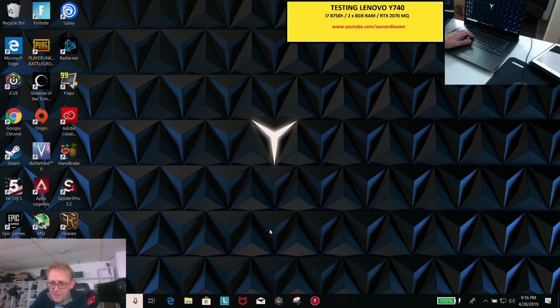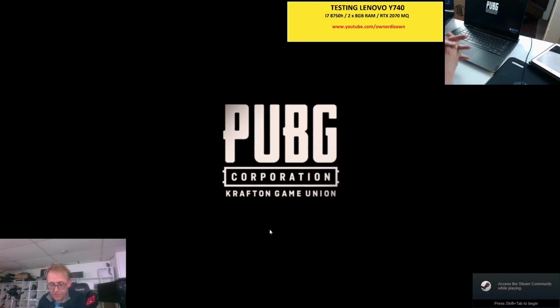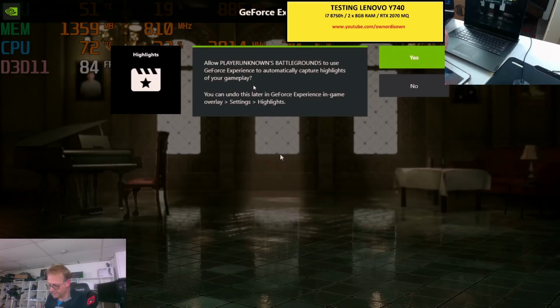Oh, they're great frame rates. I don't know if you heard what I was saying before, but I believe it's a 90 watt part here. The 2070 Max Q is a 90 watt one. In my stats, it's pulling around 97 watts peak, that type of figure. And the frame rates in the benchmarks are similar to my 2080 Max Q Triton.